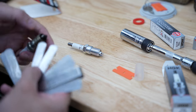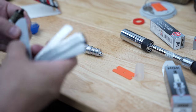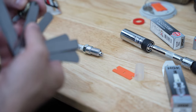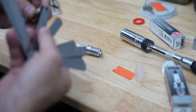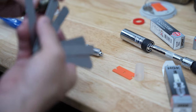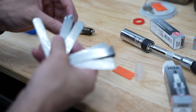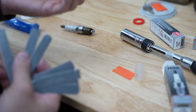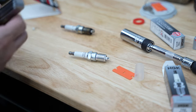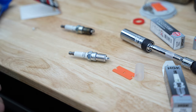Let's see here — these are getting a little thinner. I would say this one is just about right. Going to 30 over just to see how that one fits — this one is exactly snug. Fantastic, they have the same exact spacing. I'll double check all the other plugs but for the most part I can pretty much rock and roll these as long as they match. Let's get moving.